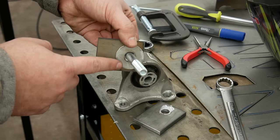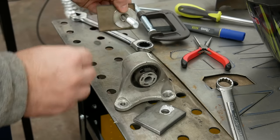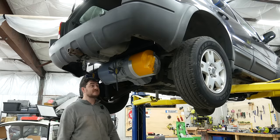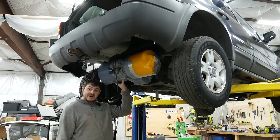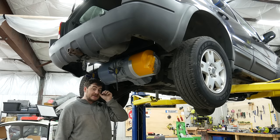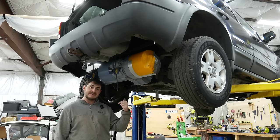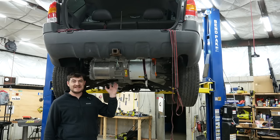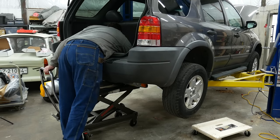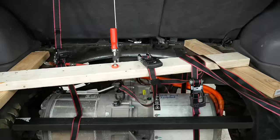To ensure proper spacing, I'm going to do the same thing I did last time but forgot to show: put in this little shim here as a spacer that I cut on the ArcDroid. While I would love to continue building drive unit mounts using this light plastic mock-up — which I printed in about 21 different pieces and glued together — the distance between the mounting holes isn't accurate enough to rely on. So I need to put the real drive unit in its place. Done! Since I cut away most of the floor, I had tons of access from the bottom and top, making this a lot easier. Right now it's being held in place by the one mount that's fabricated and three strap points on the top.